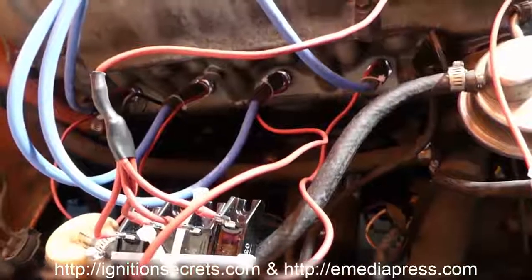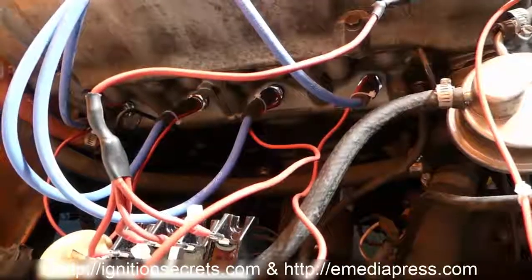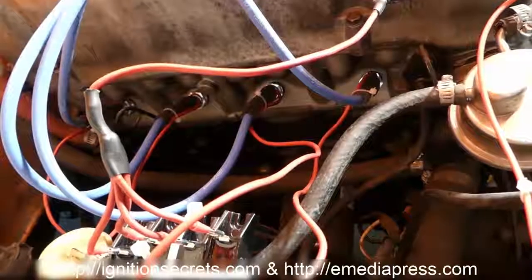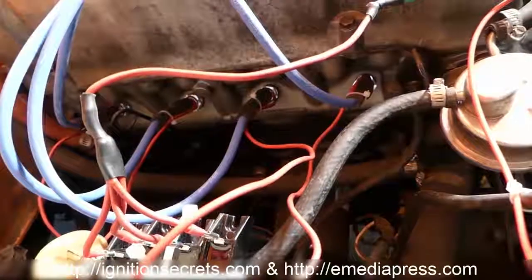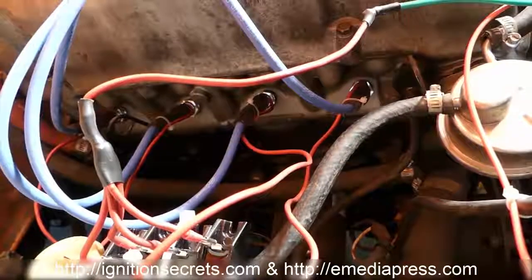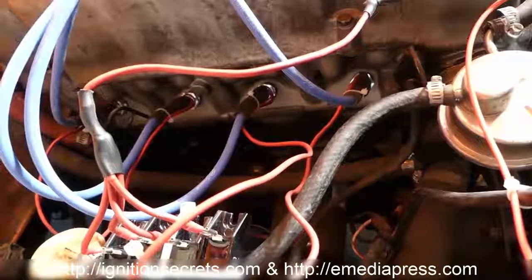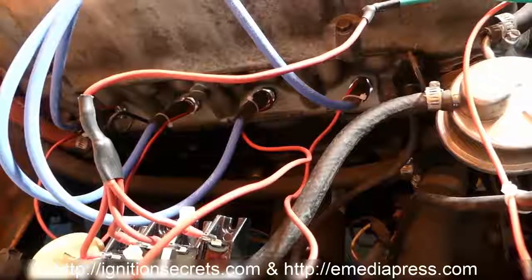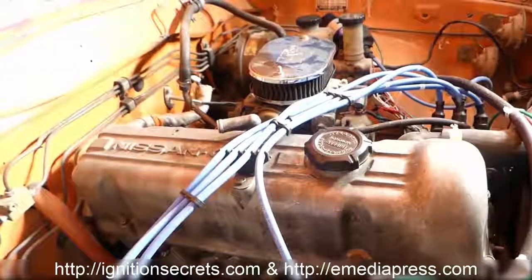And so my next move is probably going to be mounting this stuff better, and I'm going to modify the gap on the plugs. I'm going to open it up a bit. That'll give me a higher initiating voltage. I'll discharge the cap across, and it'll also speed up the cap discharge. That'll compress the discharge into a smaller unit of time, so the power will go up even more. And then I'm set for either water vapor, HHO injection, anything that I want, and I'm going to be able to lean out that Weber carburetor right there.